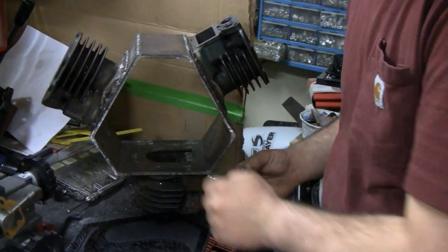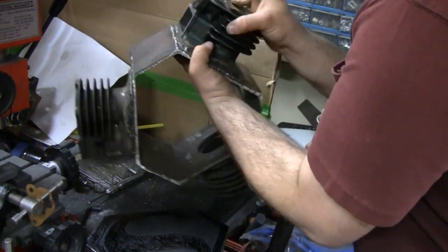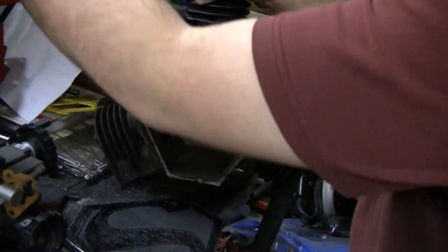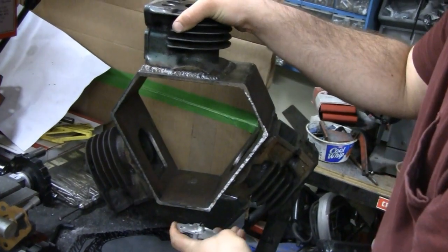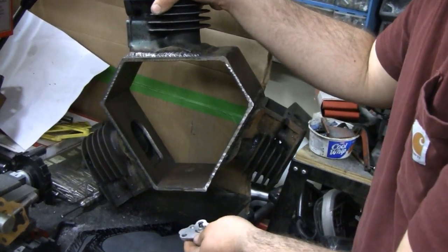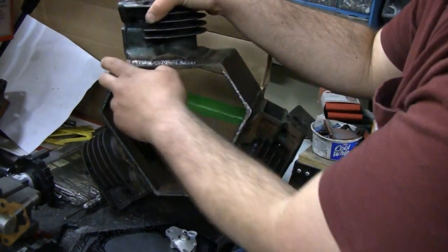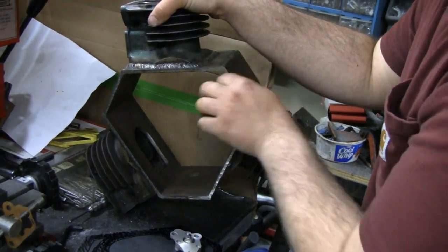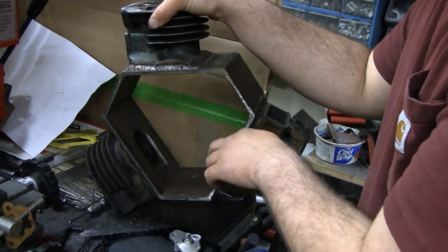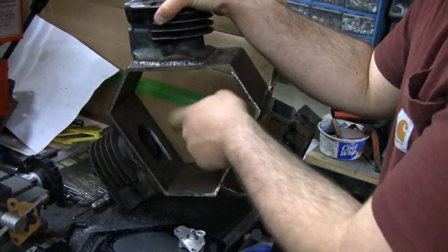It'll be pumped up to a nozzle in multiple directions. That block is upside down right now — it's gonna sit the other way. The oil pump is going to be mounted down here. There's going to be a tank mounted at the bottom. It'll suck from the bottom, and then we'll have a copper line coming up somewhere either in the crankcase or in the crankcase covers, with a little nozzle on the inside with three holes — one to spray toward each cylinder and then spraying on the main crankpin, the master rod, and all that assembly.